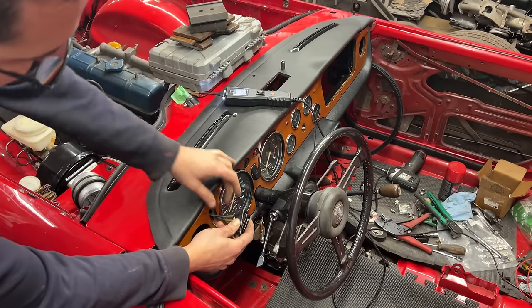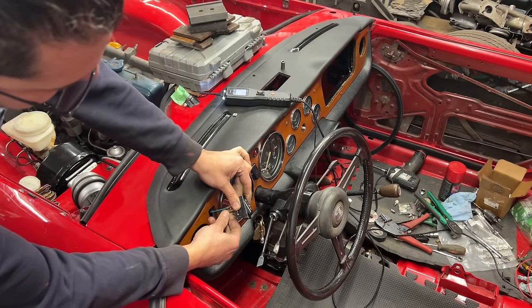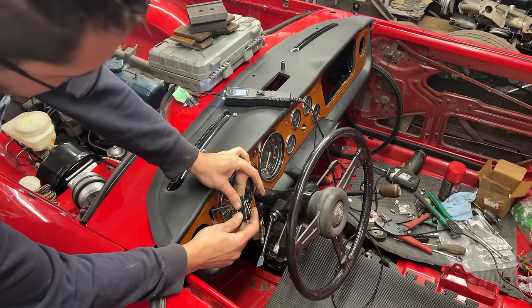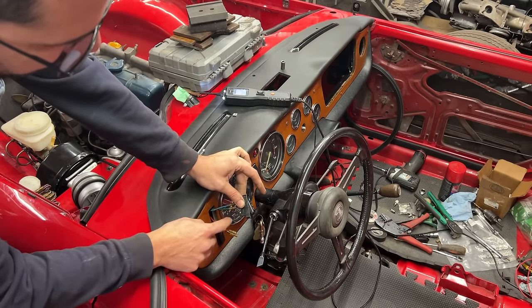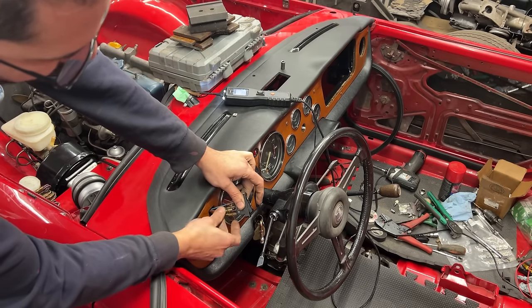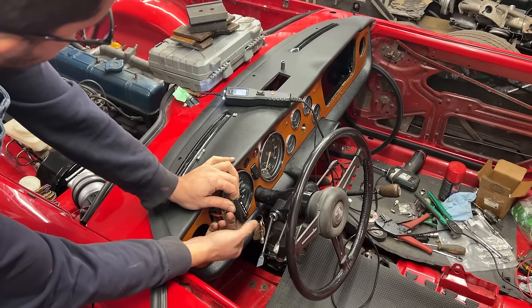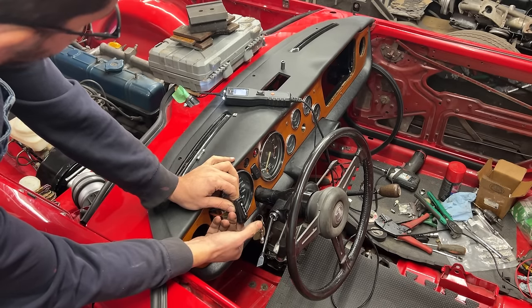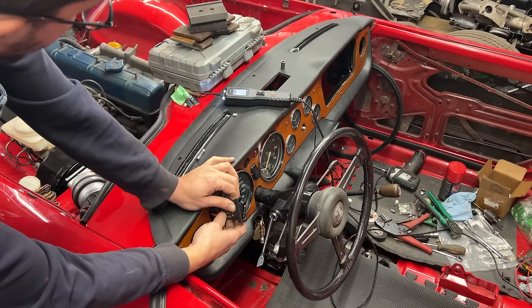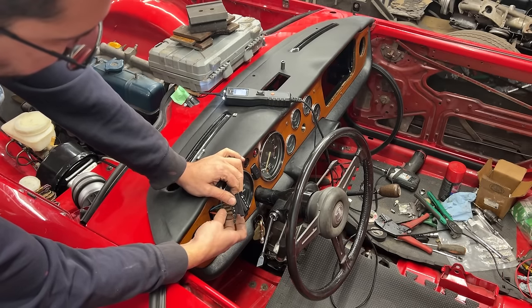There you go. So that's off, that's on. Now in the off position these two should be closed here — the switch should close them — and the motor should go to park if we connect this now. There you go, it went to park. But now if we turn it on, it runs... and if we turn it off, it should stop — but it doesn't stop. Why doesn't it stop? I don't understand. This switch might be bad, or maybe this is not the right configuration.